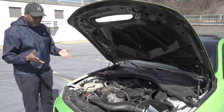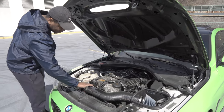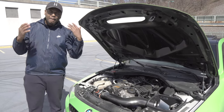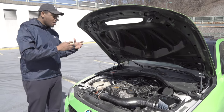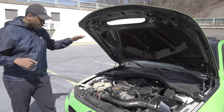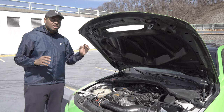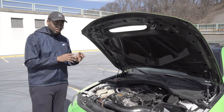Right now, first thing that probably pops to your mind is this carbon fiber — I got to clean this thing. You can see right here the Turner Motorsports carbon fiber intake. Obviously it fell down this path because I then added a big boost turbo setup. It is a Master Power 6564 bolted onto a Big Boost kit, with the VRSF front mount intercooler. All the piping is supplied by the Big Boost kit up until the charge pipe — that's the VRSF charge pipe still left from stock. I finally got that sucker to stop leaking boost.